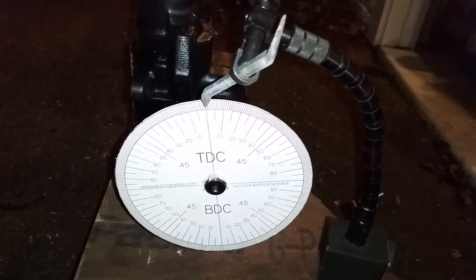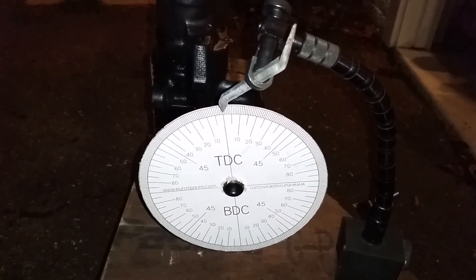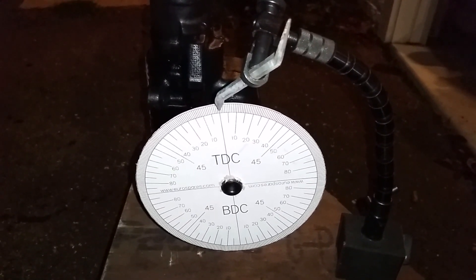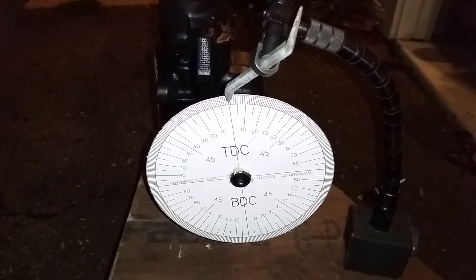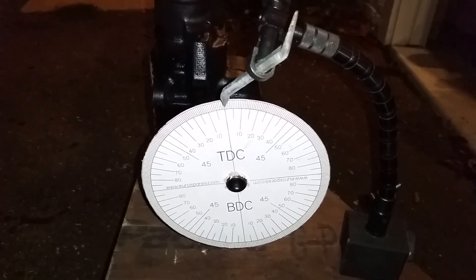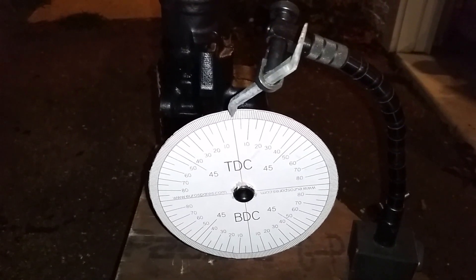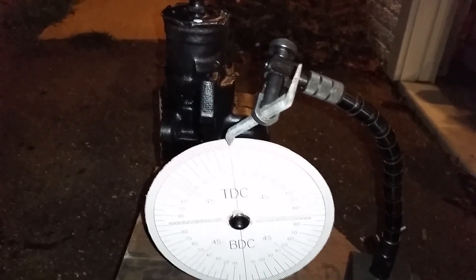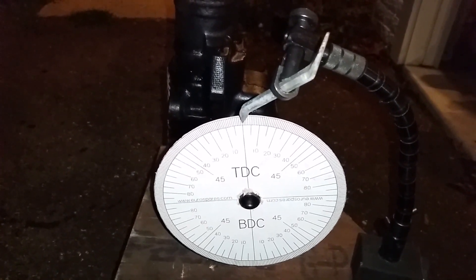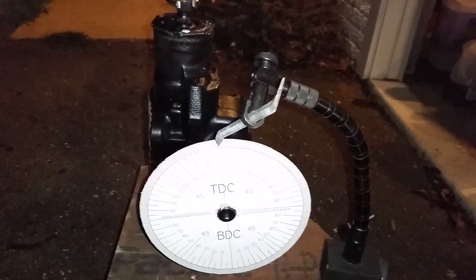Right now I've got this centered. I've actually already tried this so I know what we're going to see. The F-body boxes are supposed to have somewhere around 62 degrees travel — cranked all the way over. I know it's under 70. I think it's supposed to be 70 degrees if you had 15-inch wheels, and like 60 something — actually I think it's 67 degrees. Either way, it's somewhere in the 60s.